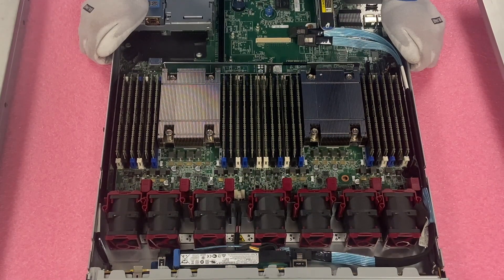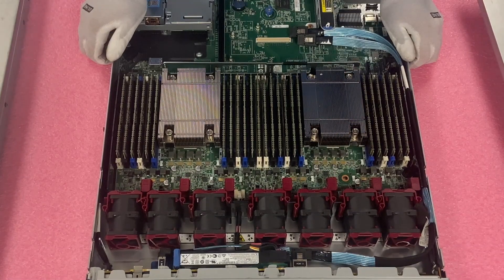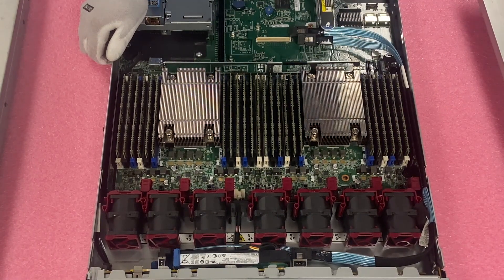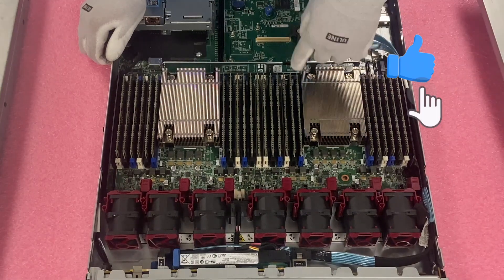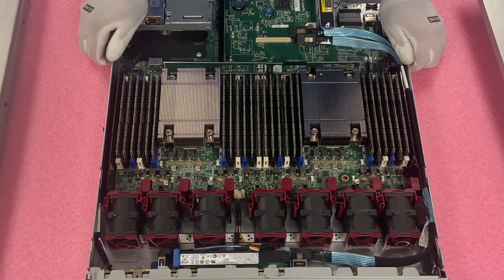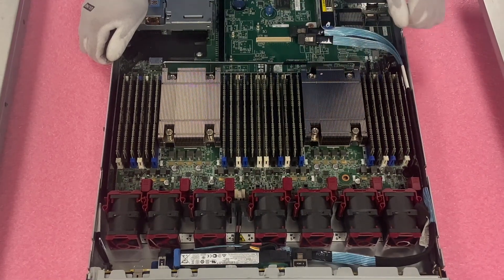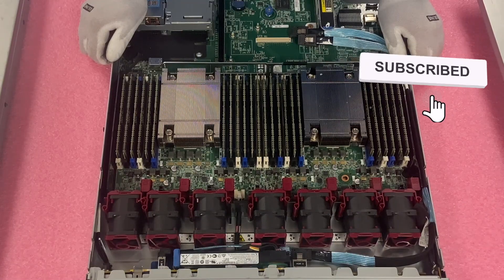We have loaded up all 24 DIMM slots. I want to stress the point on speeds: once you load up all 24 and have three DIMMs in all the channels — meaning you're using the blue slots — the speeds do change, and technically it changes even when you have two in the black. Check page 40 on the quick specs on our website, and that will help you understand the true speed depending on module size, CPU, and configuration. If you're not 100% sure, message our sales team — we're here to help. If you're looking for RAM upgrades, CPUs, SSDs, hard drives, NICs, custom-built servers from HPE, Dell, Super Micro, IBM, or Cisco, email us at sales@cloudninja.com. Click that like and smash that subscribe — thanks so much!